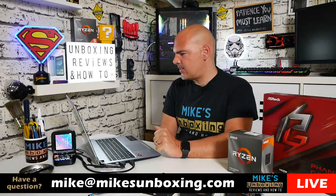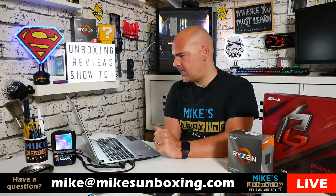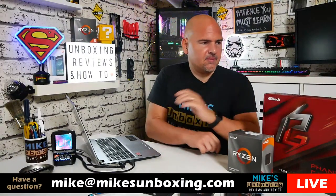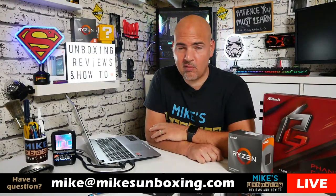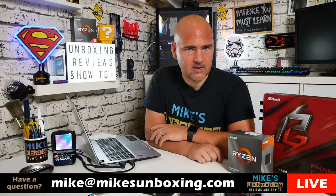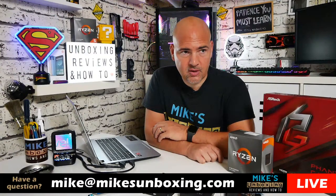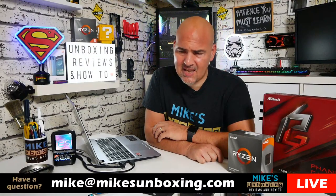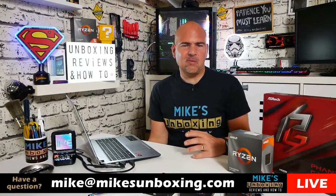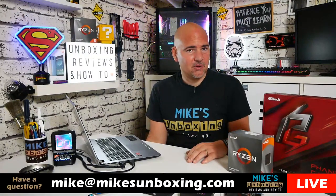Tristan G says, am I correct in discovering that the 2000 series Ryzen, i.e. the 2600X CPUs, aren't compatible with the B550 motherboard? You are absolutely correct. Yes, I've looked at the BIOS of this today, and the BIOS covers basically about 13 processors, all of which are Ryzen 3000 parts, not APUs, only CPUs. So Ryzen 3 3100, 3300X, 3600, 3700, 3700XT, yeah, basically those range of chips, that is all that is supported on these boards. Although I'm desperately, desperately wanting to put a Ryzen 7 1700 on there and see if it will actually do anything. There have been people that have said that it is possible and it will happen.